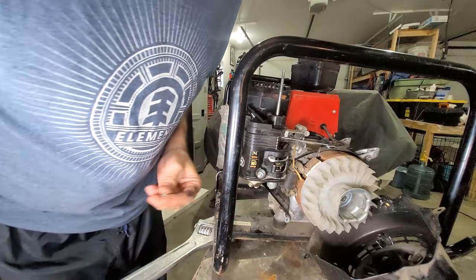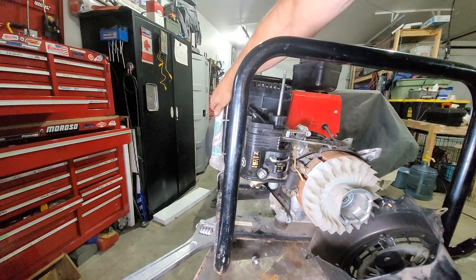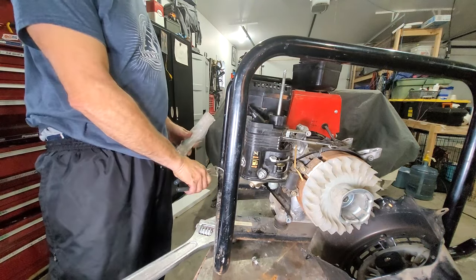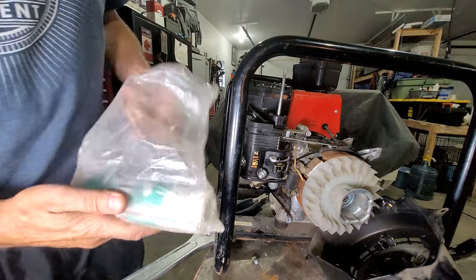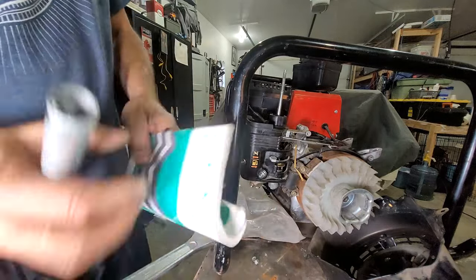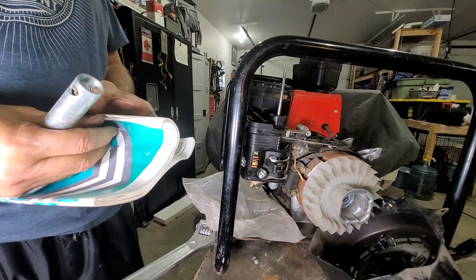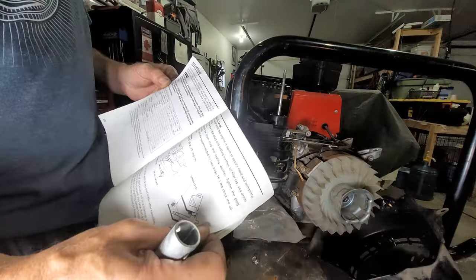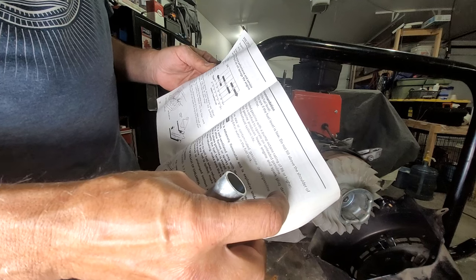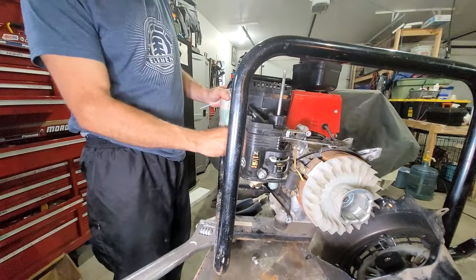Who remembers where these two go? Right back here. Owner's manual is going to tell me what kind of oil. I think there's a spark plug tool in here too. Yep. So you can read it more. All right. Oil type, page 21, it says. Oil, see page 16. Page 16 says for minus 20 to plus 20, 10W-30. I got some of that. How do I have that?